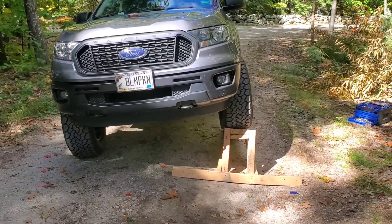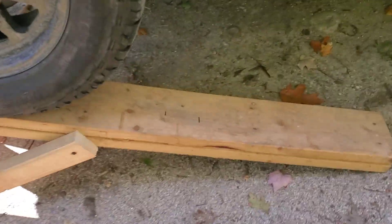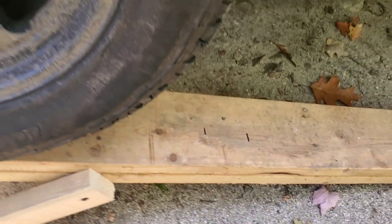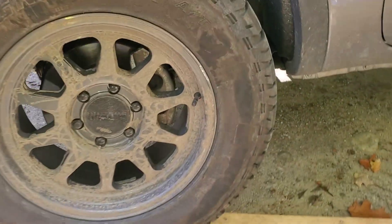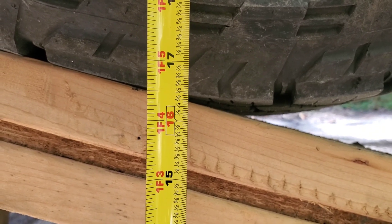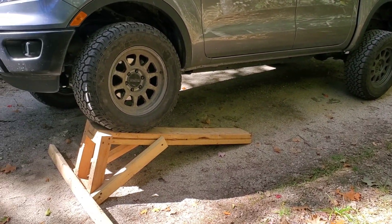Measurements have been taken. I'd say our naysayers have been sufficiently disproven. If we put a tape on this second mark, we get almost four and an eighth inches further up this ramp with the sway bar end link disconnected. And taking the measurement from the center of the tire to the ground again, it's almost 16 and a half inches — so another inch and a half of wheel travel before that back tire wants to come up, and over four inches further up the ramp.